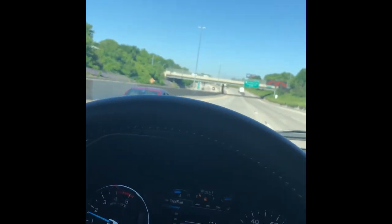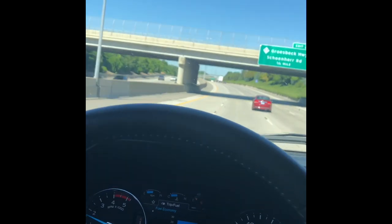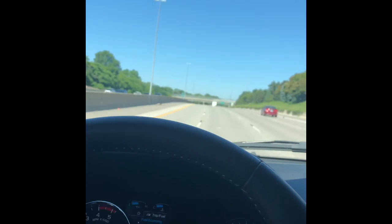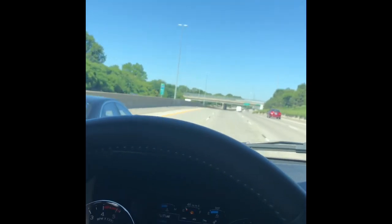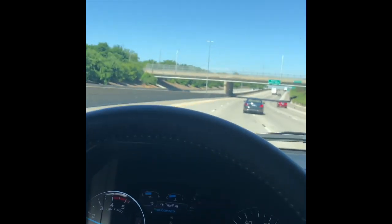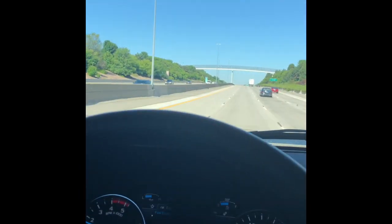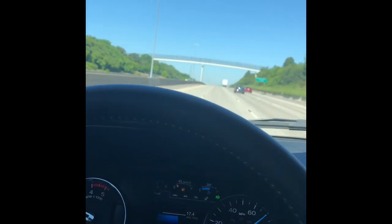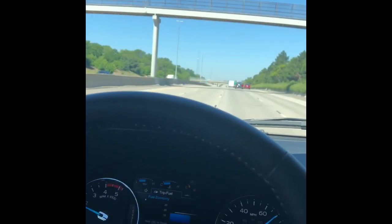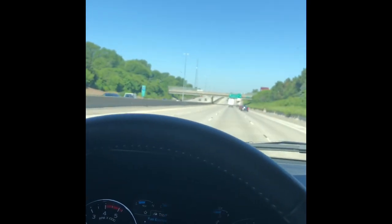If you use some amount of caution accelerating... you're going to burn the most fuel getting on it to get up to speed. So if you want to get good fuel economy, your goal is to tip in and just let the truck let the torque do its thing. That's where you're going to get the best fuel economy. If you're pouring on the coal or the corn, as some people say, you're really going to get poor fuel economy, because that acceleration going through all those gears at a high amount of load is just going to burn fuel.